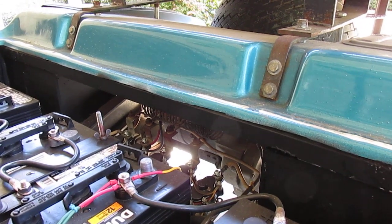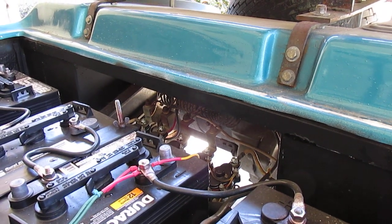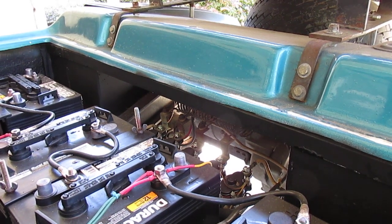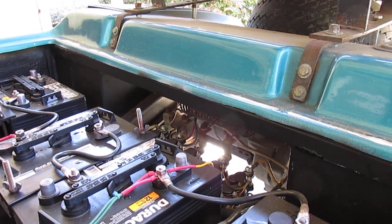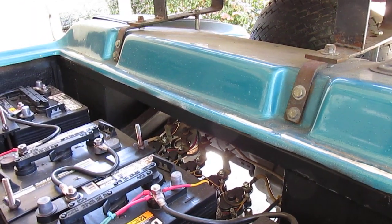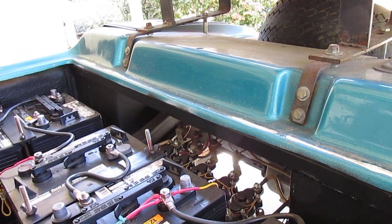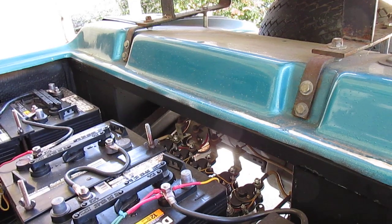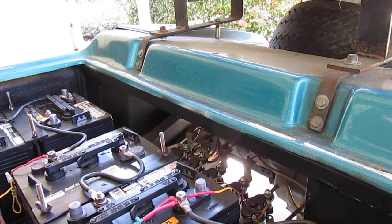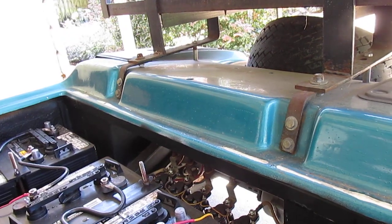The system works pretty good — I've had this thing for many years. There is one problem with it, especially if you use these golf carts for long-term usage like riding around the neighborhood for several miles. Those relay coils can get very hot. Even though they're probably designed for continuous duty, I found that the relays will go bad after a period of time. I actually opened one up to see if I could tell what was going on.